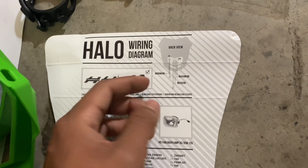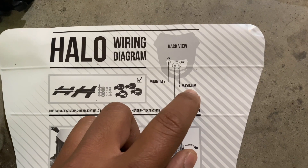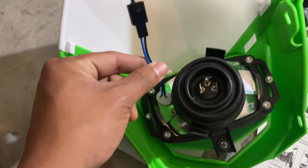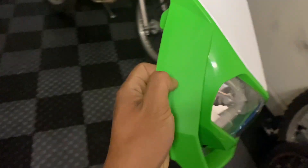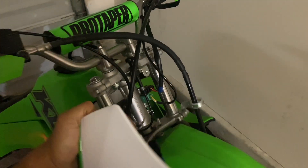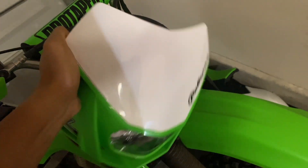The right pin is for high beam — it's laid out on a diagram in the back, just like an H4 bulb for a car. This is a 35-watt bulb, so maximum power is the right pin, left side is the ground. There's also a daytime running light — a 4-watt bulb — if you want to wire that up. The finish of it: the outside is matte and the metal section is gloss. The color matches the Kawasaki plastics perfectly. Looking over the fork, my choke is positioned right in the center, which is going to interfere with the back side of the housing, so I may need to reposition it to the side for proper clearance.